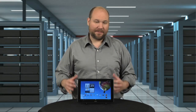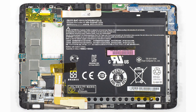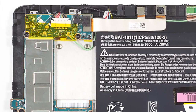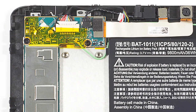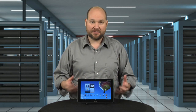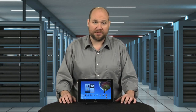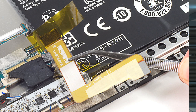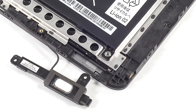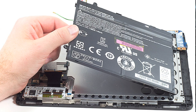So what don't I like about the A510? For starters, Acer continues to cover most of the internal connections with what looks like Kapton tape. While this translucent film can insulate connections and help hold wires in place, there are plenty of PCB and connector designs that don't require its use, and it makes removing and replacing components more difficult than it needs to be. I also found it frustrating that you can't remove some components without first removing another unrelated piece of hardware — for example, you must remove the speakers and volume/power button circuit board before removing the battery.